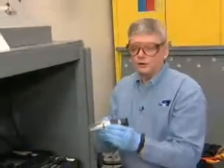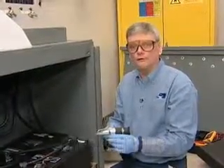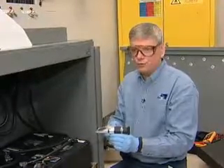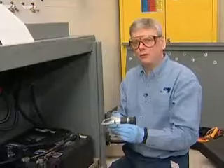That was just one particular cell. When you're going to do this test, do all the cells. If it's a six-cell battery, as most are, then you're going to do all six cells. If any of the cells are below 1.225, it should be recharged until they are all above 1.220 or 1.225.